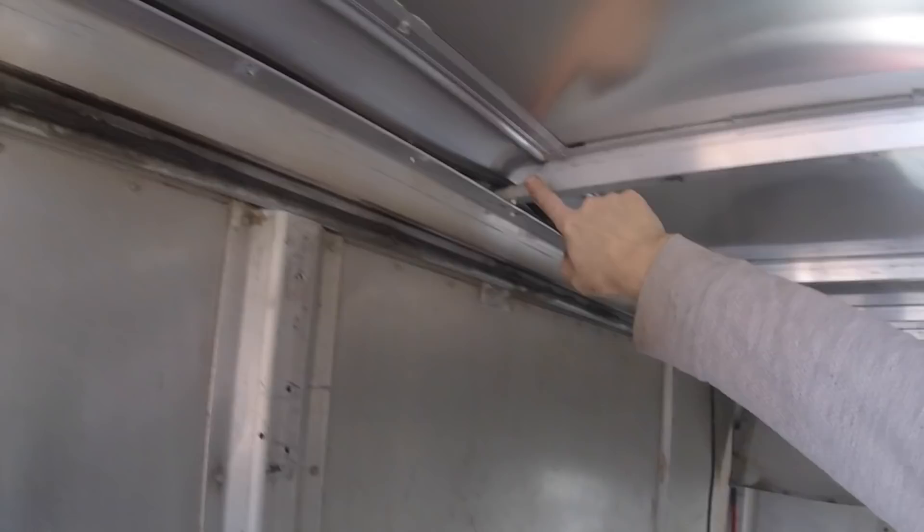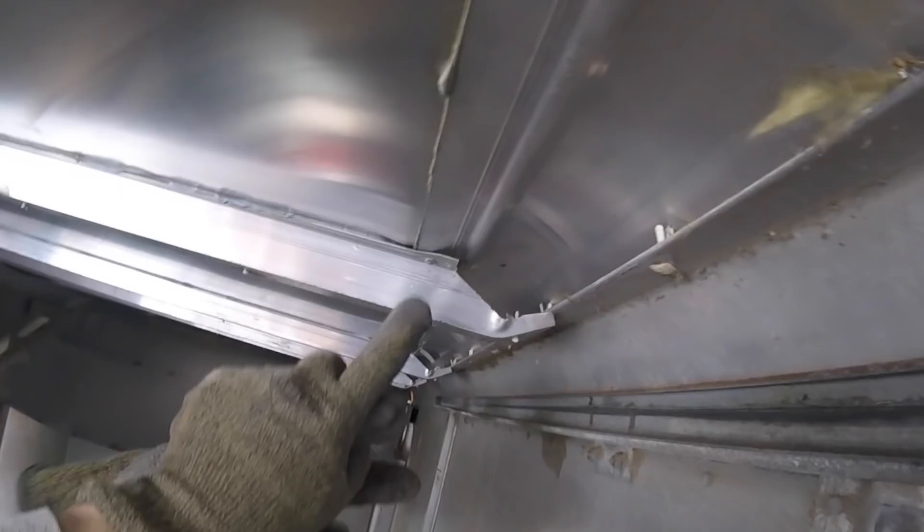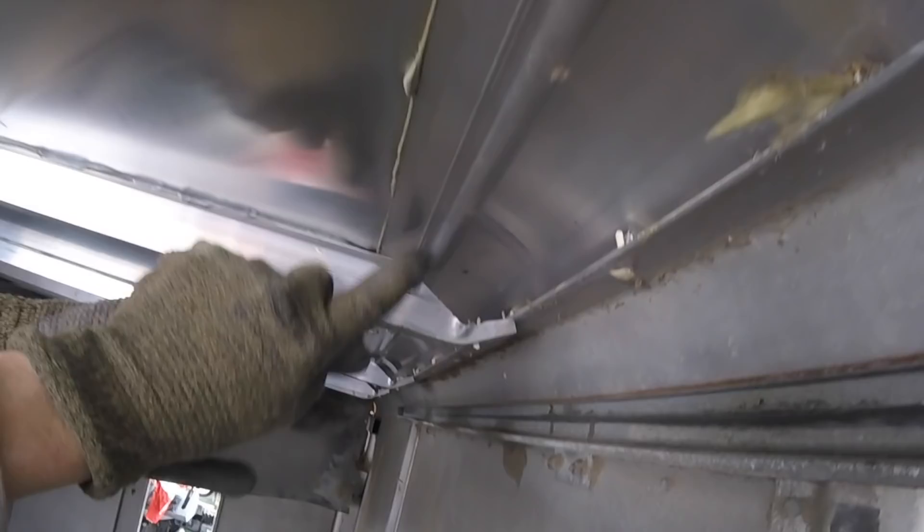You can see this is what the corners are supposed to look like — there's a nice straight roof, but the roof line on this side has been compromised a little bit. It's dented down and it came in just a tiny bit, so I have to very carefully try to bend that back out without running the risk of losing the waterproof seal.